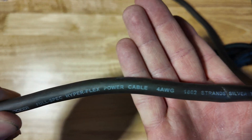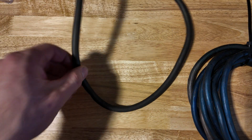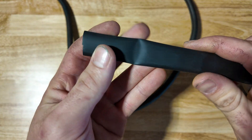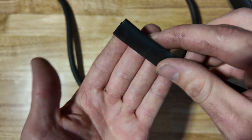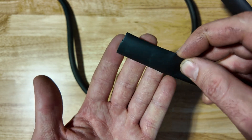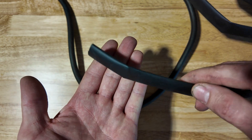This is just some Kicker brand power cable. You can buy it at audio shops or on Amazon — just make sure whatever wire you buy is copper or OFC copper wire. Also, welding cable works really well. As far as making the ends look nice, I use marine heat shrink. It has glue inside, so once you melt it, it creates a nice glue bond and seals the joint up really well for moisture. I'd highly recommend using marine heat shrink on all your ends.